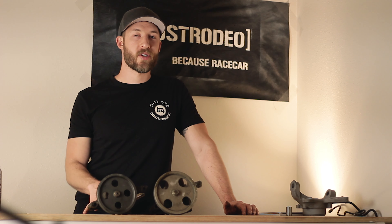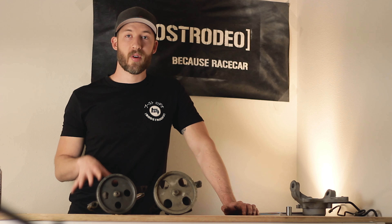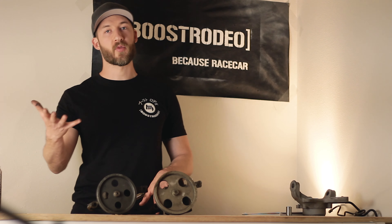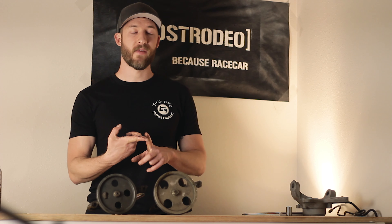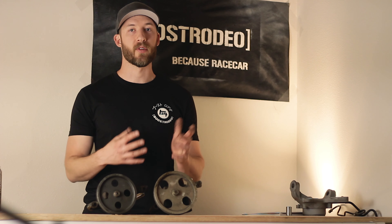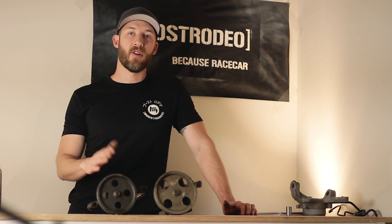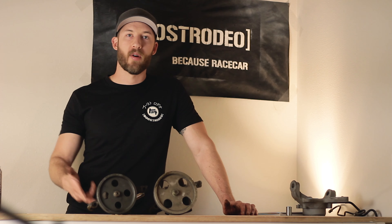Now let's move on to the JZ pumps. There's a ton of questions online because everybody and their mother is swapping JZs into these cars. Basically you can use almost any JZ pump — they're all the same. The pump is the same whether you're using the stock 1JZ non-VVTi that came in a JZ A70, a Mark 4 pump out of an A80, or the SC300 GE pumps, which are all interchangeable. The Mark 4 pump does have one additional mounting ear but has all the same ones, so they'll all bolt and interchange between one another. If you're doing a JZ swap and don't have a pump, you should be able to get one at pretty much any parts store or off Rock Auto for either an SC300 or a Mark 4 since they were sold in the States.